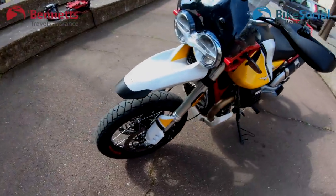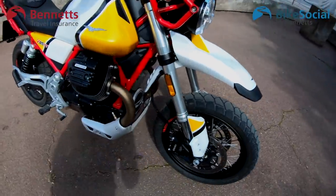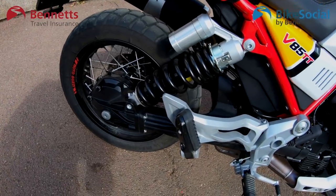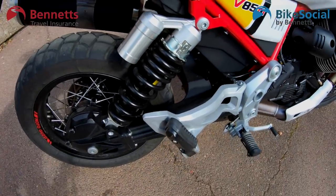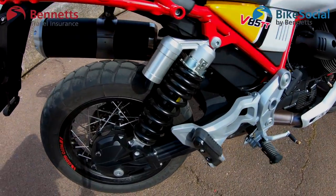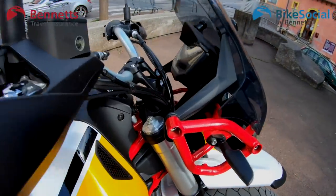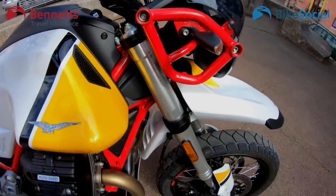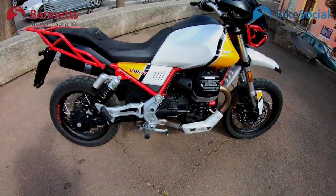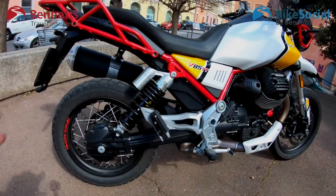Suspension wise, got to tell you about the suspension. So these Kayaba units, they're 41 millimeter forks and it's a single Kayaba rear shock. Now it's got progressive springs and the fork springs are progressive as well. We've got adjustable preload and adjustable rebound damping at the back, and we have adjustable rebound and adjustable preload at the front. And these are some among the better quality standard shocks.